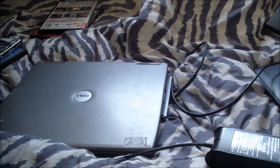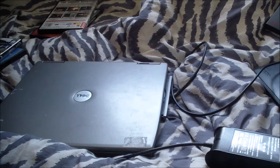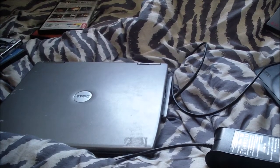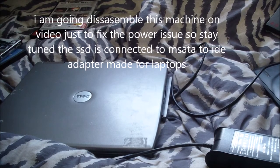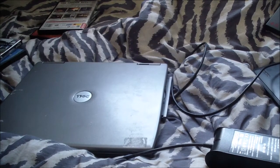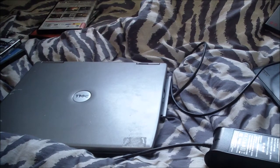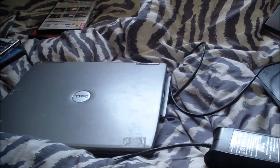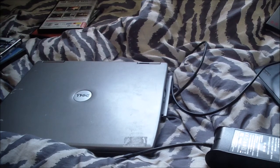It's got a 128GB SSD inside it — an mSATA SSD, just a cheap one off Amazon. It doesn't need to be amazingly quick, but it holds the OS and basically the games. I did try and get the PCMCIA card to work as a storage device, but the PCMCIA drivers and USB drivers are just not working on the machine. I've tried forcing them to update drivers — it's just not going to happen. Until I find a way to actually get it to work, I'll keep you updated but I'm not really hopeful.